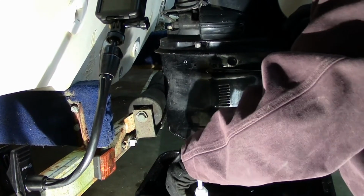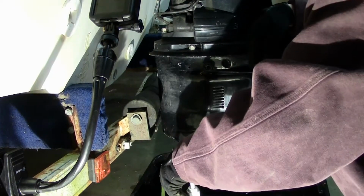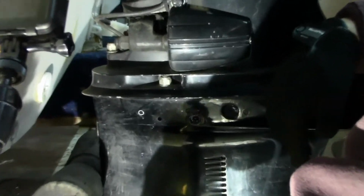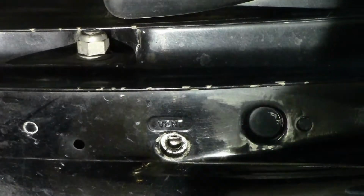And having that clear hose, you're going to see your lower unit fluid start to go through. How much do I know to put in here? What you're going to do... Do I do it until it comes out the vent? You're going to be watching till it comes out the vent. And I'm going to do you a favor here real quick.